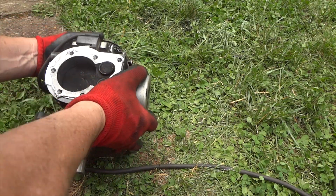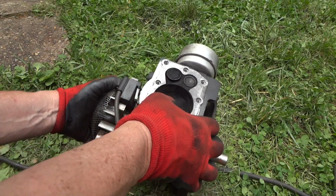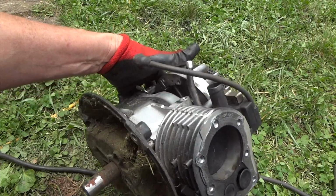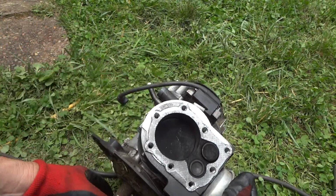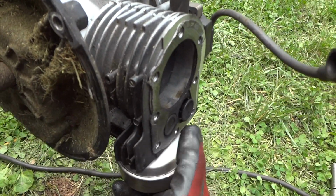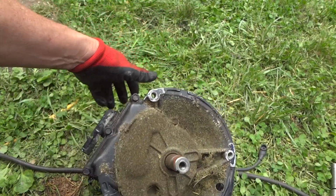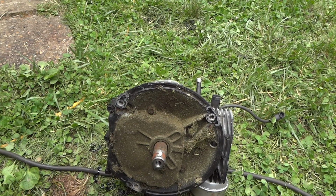Alright, so here's the motor we're working on. Boy, these things are light, nothing to them. I'm not sure which valve, but we're going to lap both of these valves. We're going to pull the bottom of this case off, four or five bolts. But you can see around that seat there how black it is. This one's even worse. So we'll just go ahead and do that. I got the oil drained out. Might as well just go all the way with it.